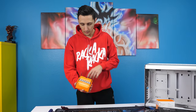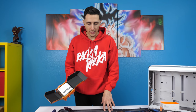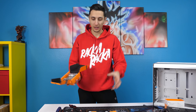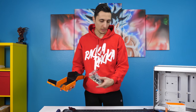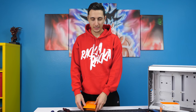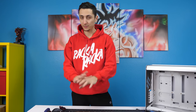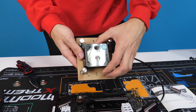I guess the next step would be to put on the CPU block. I really wish I was able to use a monoblock because I really do want to cool the VRMs, which is going to help with overclocking and thermals. But there is no available monoblock for the X299 from MSI, unfortunately. So I'm going to have to use a basic CPU block from EK. If I were to use a different X299 motherboard, I think EK does have available monoblocks. But this is the one I want to use for my build because of the features it comes with — it's also RGB, so it's going to light up inside.